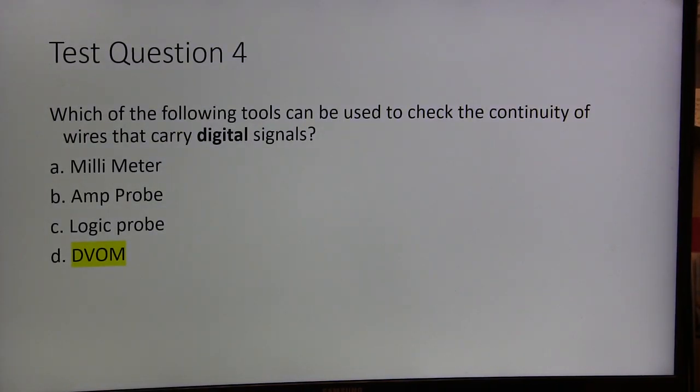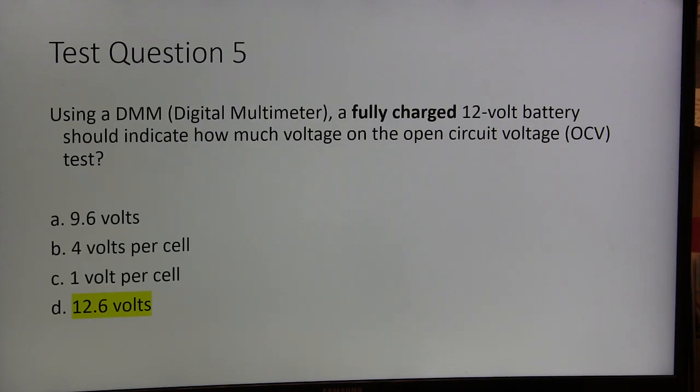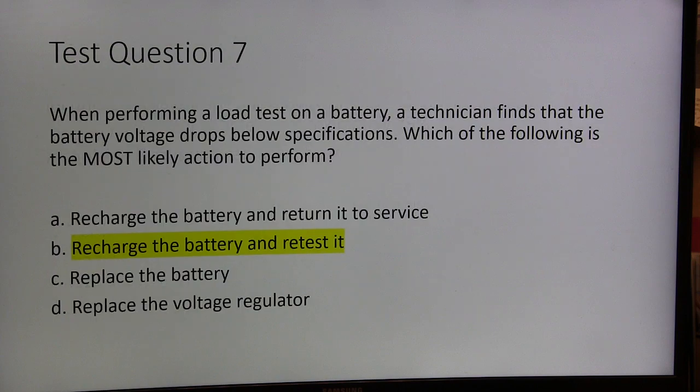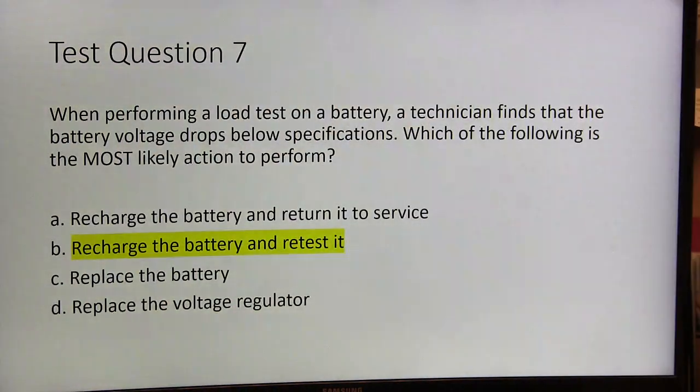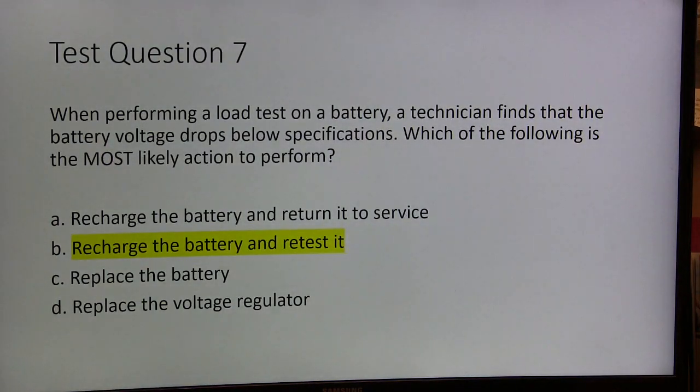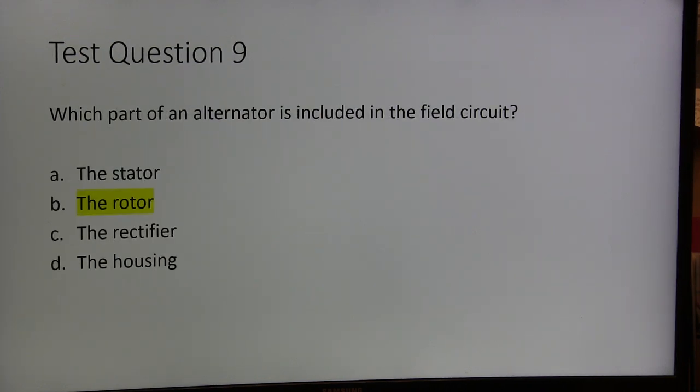Now for the answers. For voltage drop, you're on the same side of the circuit — both leads on positive side, or both on negative side; you're not going from positive to negative when doing a voltage drop test. In a series circuit, current travels through all the loads to find ground. When measuring DC voltage in parallel with a device, you're seeing how much voltage is dropped across that load. For digital signal continuity, use a DVOM. A fully charged 12-volt battery should read 12.6 volts. For the hydrometer question, B only — hydrometer works if it has cell caps, though I prefer a refractometer. For the load test, recharge and retest. For zero alternator output, both A and B are correct. The rotor is the field circuit — it's the part that spins on the inside.